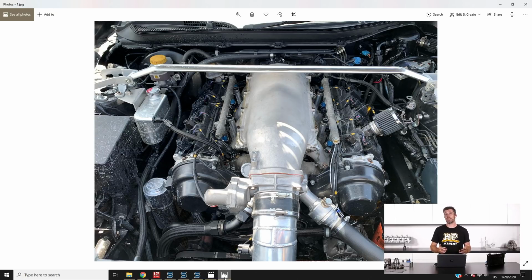Placed them in the car thinking that that was going to fix all of our issues. Couldn't be further from the truth. Now, the 1,000 horsepower axles, part of the strength improvement is that they actually run a larger spline in the outer CV, and of course to do that they also run a larger wheel bearing with a larger internal spline. That's all bolted, and it's relatively quick and easy to change over. And we placed those axles in the car basically the first time we went to the track, did a handful of laps, and ended up with the inner CVs popping out of the LSD centre.